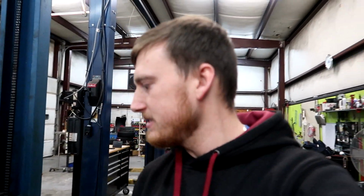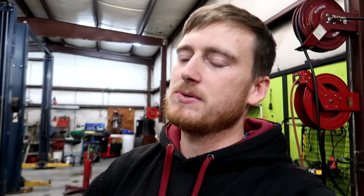Now I can't tell you guys the shot of nitrous I got, because I got to keep that a secret for my grudge racing stuff. So pretty much most of the time, guys, on any sort of nitrous setup, whether it be a 50 shot or a 100 shot, whatever, most of the time you're going to want to go 2 heat ranges colder than stock. Now you don't have to do that in every scenario with nitrous, but most of the time the standard is 2 heat ranges colder on at least a 50 shot of nitrous and above.